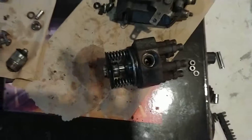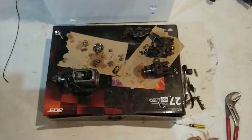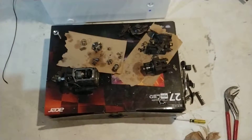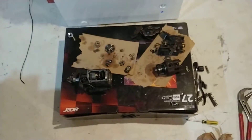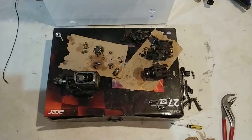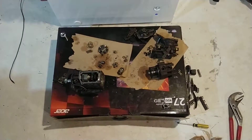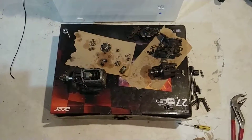That's when they talk about getting smoky injectors. If your injector gets too big, your fuel pump will not be able to meet the same pressure while flowing, which means your spray pattern will be a little worse. Then you need a pump that is larger displacement, or you can upgrade to the P7100 pump like most people who want to make big power do — but it's expensive.